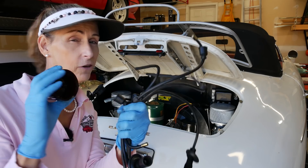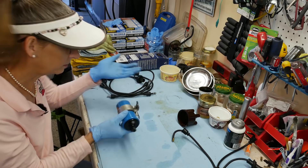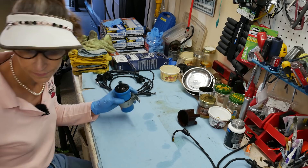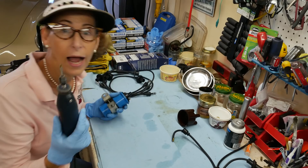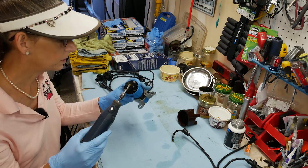With all our wires and distributor cap, let's head back to the bench and refit everything. Since we have so many things to do, why not start with the coil and just get it out of the way. The inside of this thing — oh my gosh, it's really dirty. You can see all that corrosion in there. I have a brass wire bit on the end of my Dremel, so I think that's what I'm going to use to clean this out.